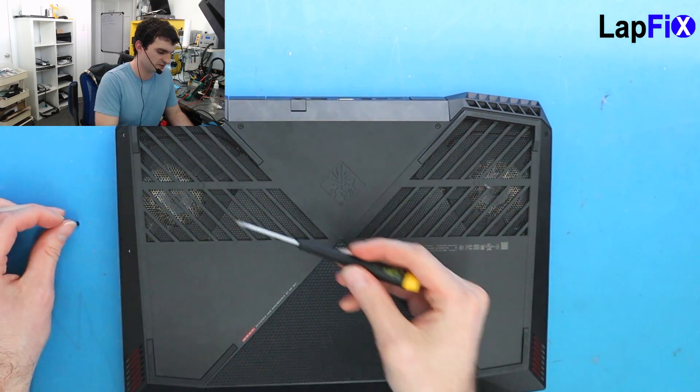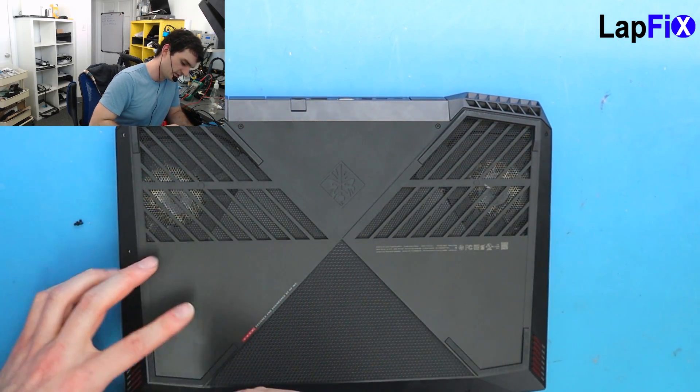So what we're actually going to be doing today — you can see there's a little bit of dust right there. I just let the customer know we can put some extra thermal paste on there and we can clean out the fans. When the chip contacts the metal of the heat sink, there is a little bit of a barrier there. You don't want the chip completely touching the heat sink by metal alone. You want this little base called thermal paste. What that does is it disperses heat more, making thermals a lot better. I'm just going to open this up and show you. You can see how dirty the fans are here, so we're going to be cleaning that.